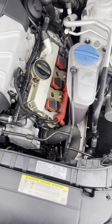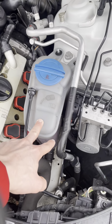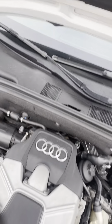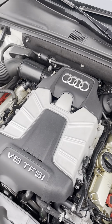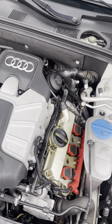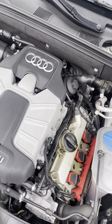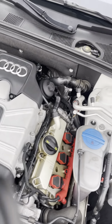I added coolant and then I had to bleed the cooling system, which meant taking the cap off of this and the supercharger bleeder screws in there. I also had to take out this whole cowl and then back in there, kind of in the center for the heater core, you will have to bleed that out — just disconnect that hose. After I got the cooling system bled out, everything was fine. I did have to clear all the codes since it was still saying cooling malfunction on the dash, but once I cleared it, everything ran out good. I had my heat back and no leaks.